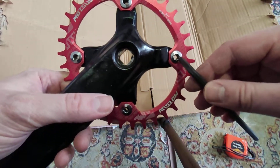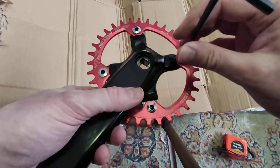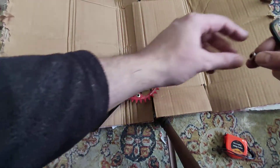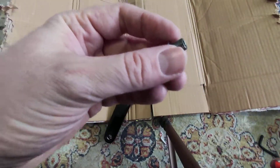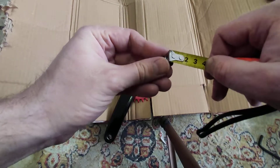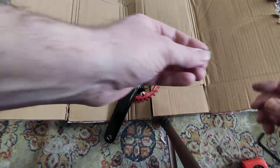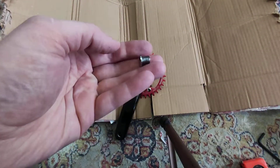In this video I'm going to show you how to measure these bolts and how to determine which kind of bolts you need. This crankset is using 8.5 millimeter bolts. To measure that, you get a ruler and measure under the head — in my case that measures 8.5 millimeters. This is a very common value, so if you have the same or a similar crankset, you will want to buy 8.5 millimeter bolts.